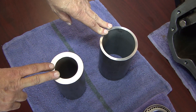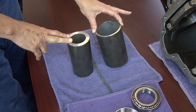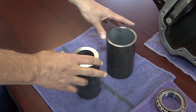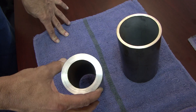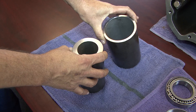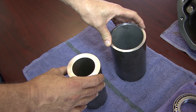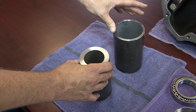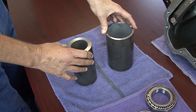One of the greatest features of the new ProRock XD is it takes a three and three-quarter inch diameter tube. That leads the industry in terms of tube size for any Dana 60 class axle or any front axle for a four-wheel drive on the market today. This is the three and an eighth half-inch wall that was very common in our older ProRock 60s and many factory Dana 60s. By going to this larger tube, we're going to be able to save weight in the assembly and give you the same strength, or we can increase the strength and still save weight — basically 33 percent weight savings going to this larger diameter thinner wall tube.